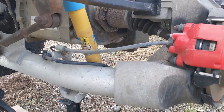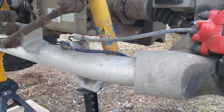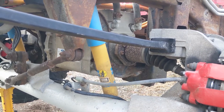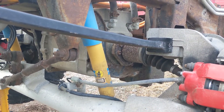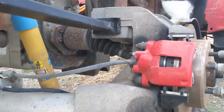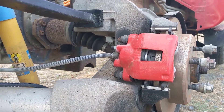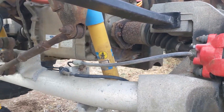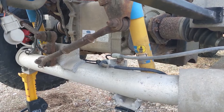This DeDion false axle basically allows them to mount the motor on the frame and use these CV boots to actually drive the driveline and drive the hubs. It frees up the axle to basically handle all of the heavy weight.